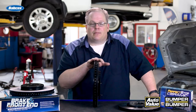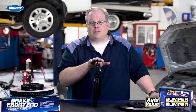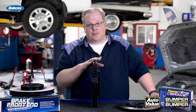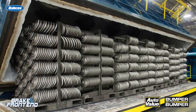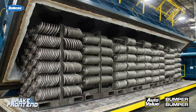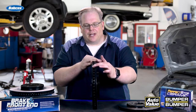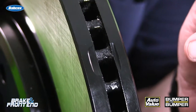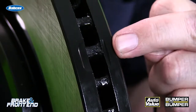Recently had a question from a viewer wondering if a vibration problem could come from a brake rotor. We all know that brake rotors are getting a lot bigger on today's modern vehicles. So it is possible, but with new brake rotors out of the box, they've been balanced. This is done typically with what's known as mill balancing, where they take material out of the outer edge of the two plates of the rotor. This helps to balance the rotor statically and dynamically, preventing a vibration problem.